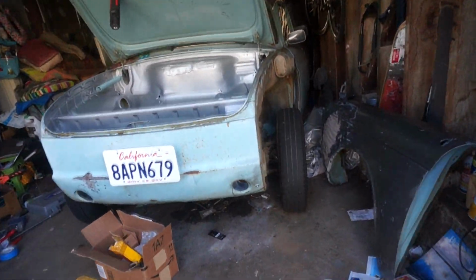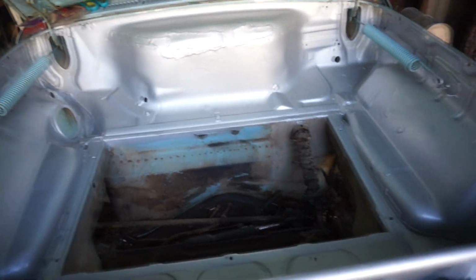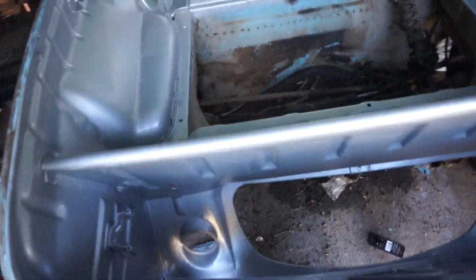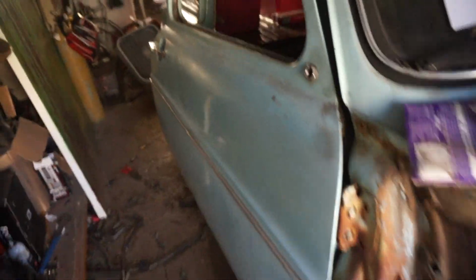Dude, I got a lot accomplished today with the second coat on the front area, so that's all done. I kind of slopped the second coat on there pretty rough, so it's going to have runs, it's going to have lines, it's not going to look completely flat, but that's okay, because I put it on super thick, because I'm going to sand it back a little bit so that I can spray primer on there, and the primer has something to adhere to.